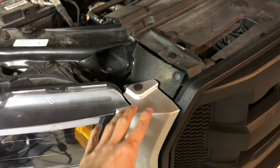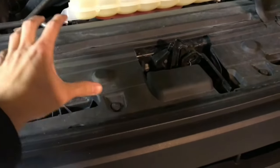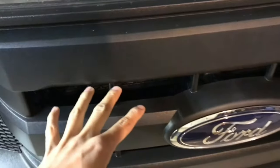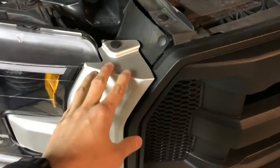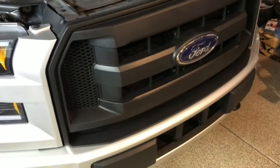We've got a lot of clips to remove, so we're going to start off by removing the clips throughout here and removing this top plastic panel. That will reveal all of the bolts that hold the top of the grill, as well as the wiring that goes directly to the front grill vents. Then by taking off the clip from this plastic panel on the driver's side, it will ultimately show the two bolts — one on each side — that hold in the bottom of the grill.